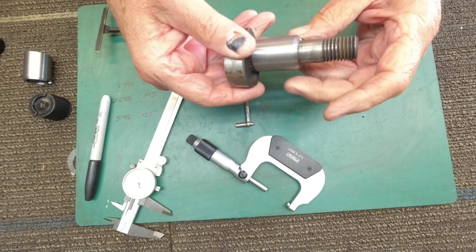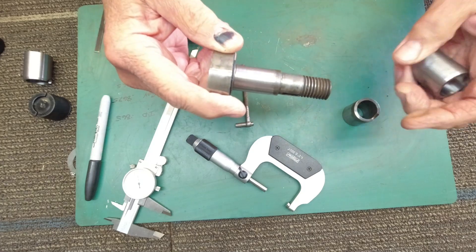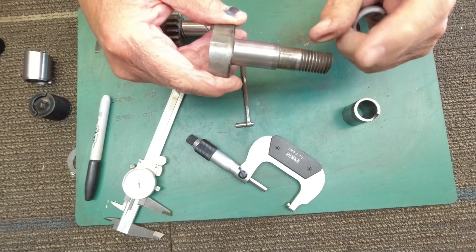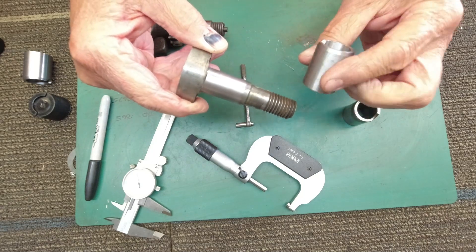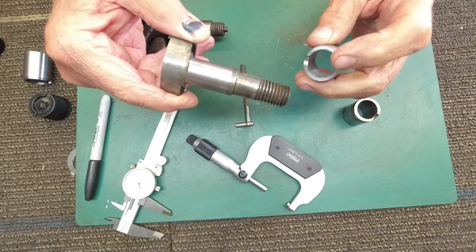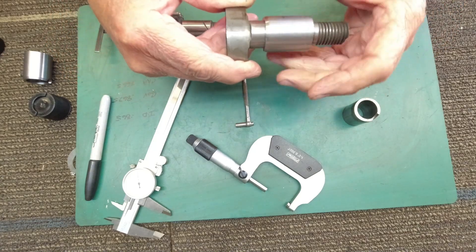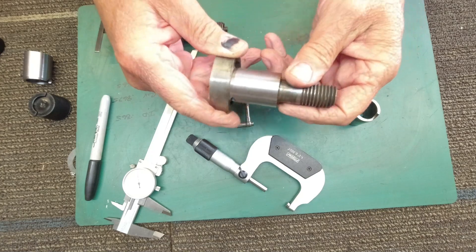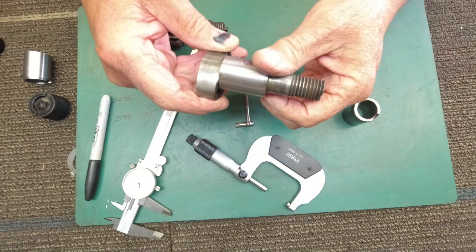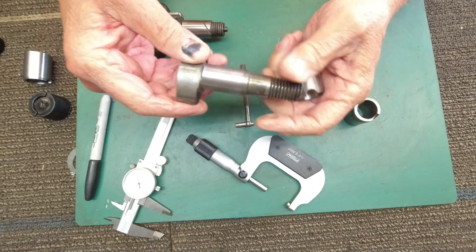Here's the camshaft. This is the new bushing. This one was so loose. What I ended up doing was filing it a little bit — I put this in a lathe and literally filed it down. I bought these new bushings from Flywheel Supply, and I bought them ten thousandths undersized. So I had to work the shaft down to take up for the wear. And now that fits very nicely — not a lot of slop.